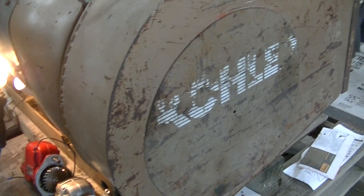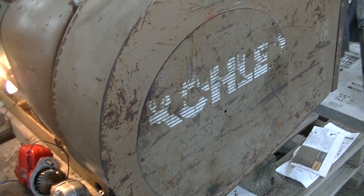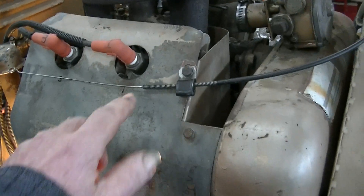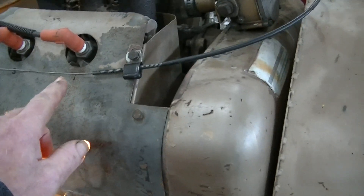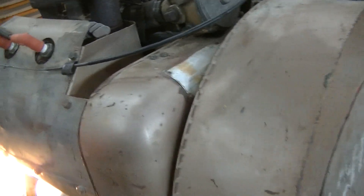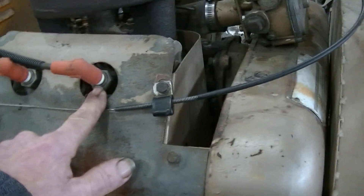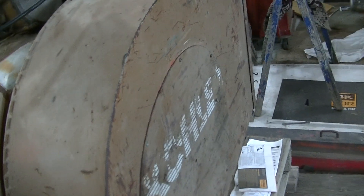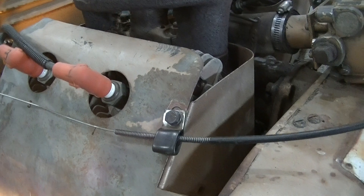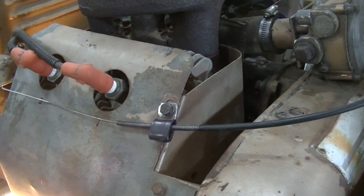The original flywheel is not on, so I had to get the cover off, which makes it a little tougher. Anyway, take number one spark plug out, rotate the engine in normal rotation — clockwise from the front — then put your finger on the hole and wait for compression to come up. There was no timing mark on the flywheel because of the different fan arrangement.